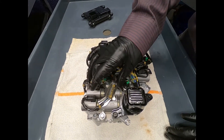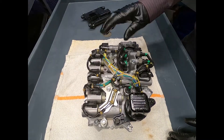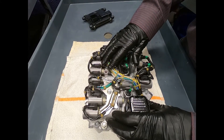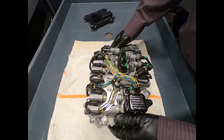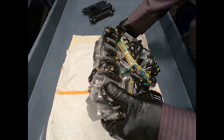One thing that has become popular with many manufacturers is that the solenoids and their corresponding valves are directly controlling the application of a clutch. With 10 speeds, you probably have a corresponding control of the individual clutches — we have three clutches, three brakes, and our two-way clutch.